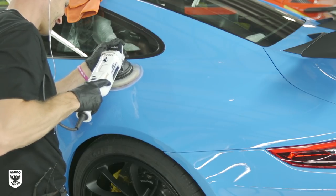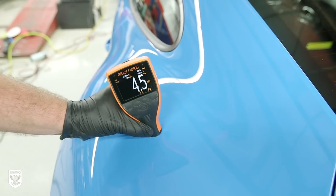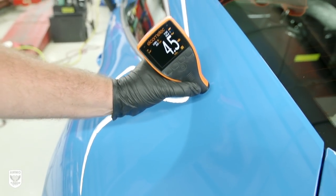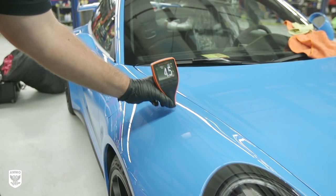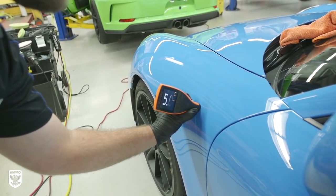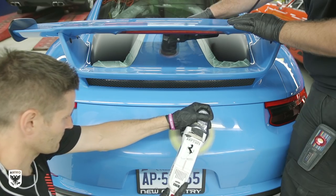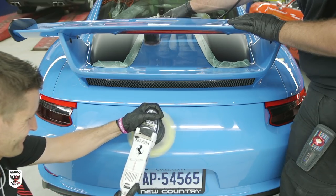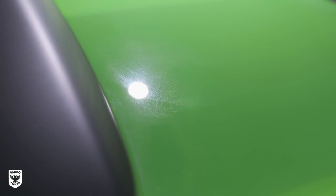After compounding and polishing out those pigtails, I wanted to see if the paint thickness on the cars was similar or vastly different. The door jambs were consistent around four mils, while the paint was around five or so — so there's really not a big difference in the consistency of the thickness around the cars. However, the quality of the finish or refinement process might vary because the sanding, compounding, and polishing is most likely done by humans as opposed to machines, so it's not unlikely to have a finish variance when you're done.